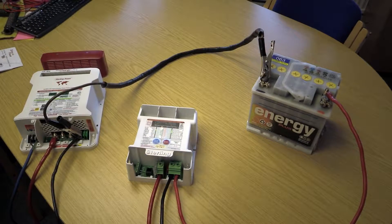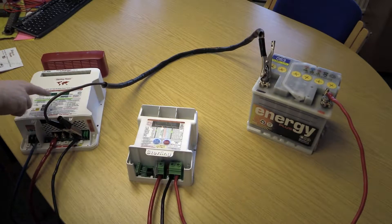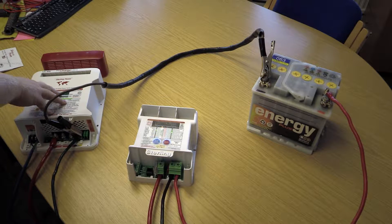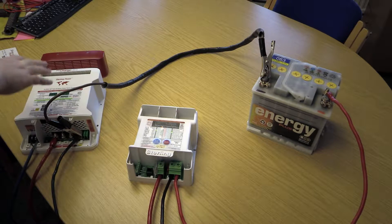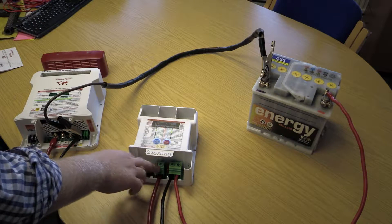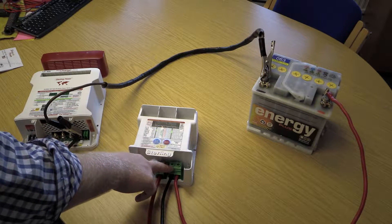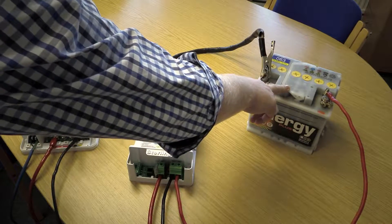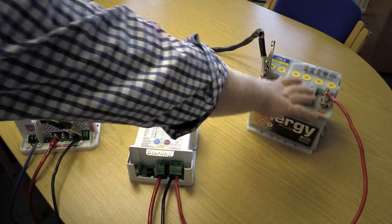Here I have a wired up ProBat Ultra, 12 volts in, and that's being provided by a ProCharge Ultra here to provide the 14 or so volts, simulating alternator input. This is essentially your alternator and your starter battery feeding in the 12 to 14 volts to the input terminal on the battery to battery charger. We've then got a common negative and then the output voltage going to what would essentially be your service battery or your auxiliary battery — input battery, output battery.